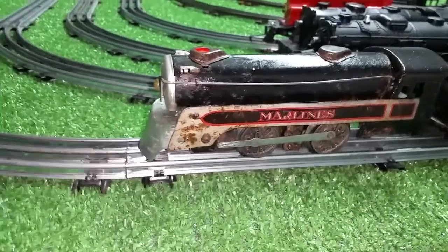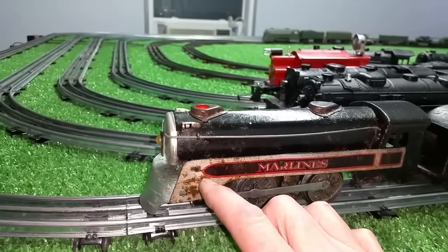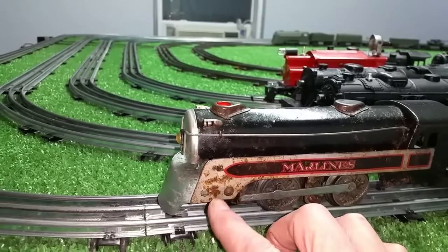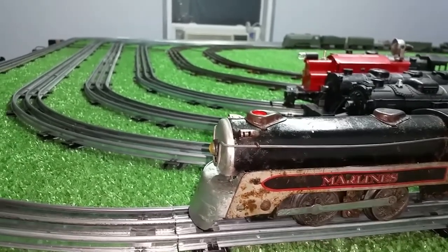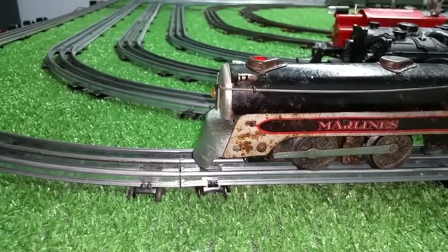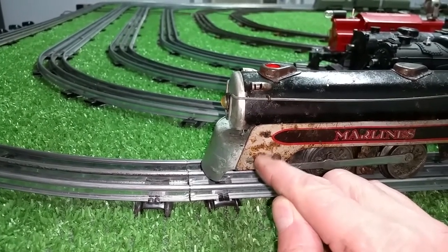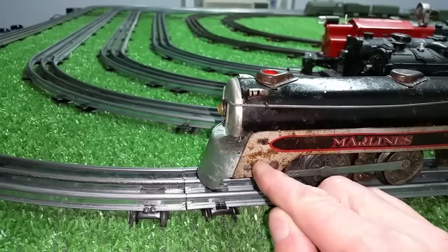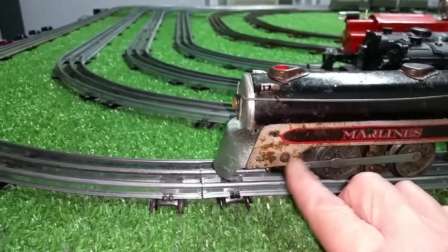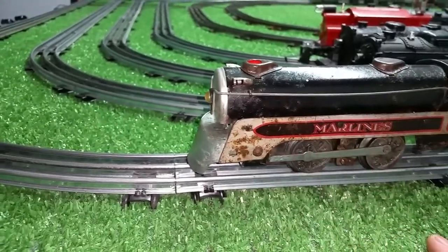There's really not much I can do here. And if I aggressively try to attack this, it's going to take the paint off right along with it. So I can lightly scrape it, but it's going to show. I'll go over it lightly with some alcohol — alcohol really seems to help breaking this stuff down. But once you scrape it silver, it doesn't match the rest of the surrounding metal. So there's not really much you can do with it other than stripping it down and repainting it.